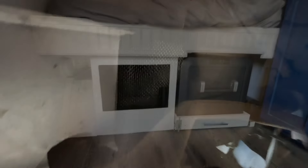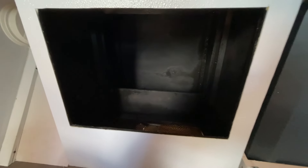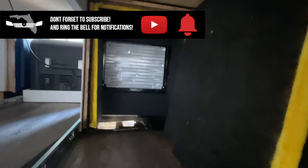It's our last chance to look inside before I put the air conditioner in and do the final assembly. We've got an FRP front here, plywood, everything weatherproofed. We finally got the air conditioner in there — everything is sealed up with rubberized paint. Insulation has been added to the hot side — the exit — so the heat is forced out through the floor and not absorbed into the walls and heating the van back up.